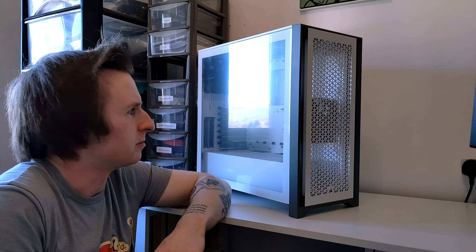We've got our case ready for putting all of our components in. We're going to start off with getting these fans installed. We have white fans and black fans — we'll use three of these up in the front for intake, and then for this system we'd probably be better off going for one top exhaust and one in the rear. Having that one on top could cause issues with dust buildup and taking the fresh air from the front and exhausting it before it's even reached the components. So we'll stick with two exhausts to keep positive pressure in the system. We'll also need to install our standoffs in a micro-ATX layout, as the case already has standoffs installed for ATX. And of course we can't forget the IO shield going in.